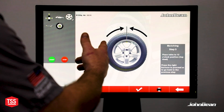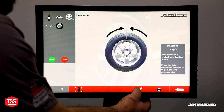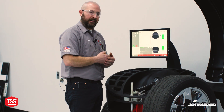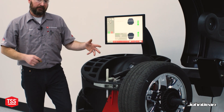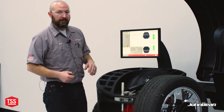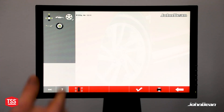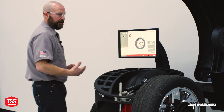When you acknowledge that, it's going to move forward and say: index the tire with something. We're going to use the valve stem for that — giving a position reference to the balancer. Check that you've done that, and it gives you the ability to roll forward and mark the tire. Because this wheel is perfect and the tire has all the fault in it, there isn't any way to twist it to improve it — that's why the distance wasn't very far. If you move it and chalk the tire, you would then dismount the assembly, proceed to break it down on a tire changer, bring the chalk mark to the valve stem, reseat the beads, bring the tire over to the balancer, and then apply the correct amount of weight to correct the vibration issue.